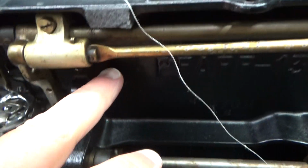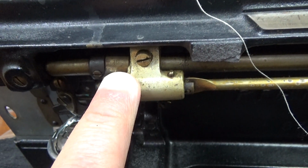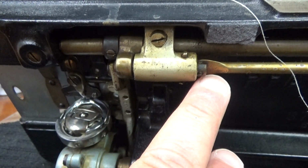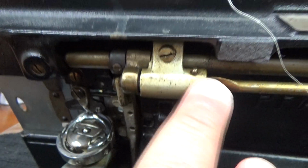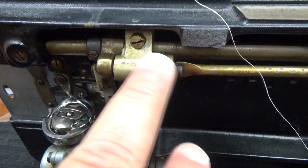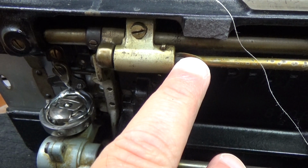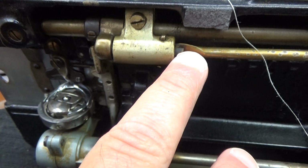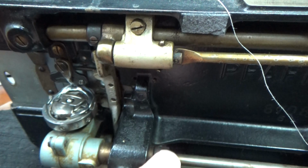We go across the main shaft. You can see we've got quite a bit of buildup right there. And this is going to be a critical part right here, because when you're trying to drop the feed dogs, this piston is going to pop out. And if you have a lot of varnishing buildup in there, you're going to have trouble actuating that feed dog drop. It's all part of this assembly right here. So if you happen to own a 130 or 130-6 and you have issues with dropping your feed dogs, or it's not responding well, this is the area that you want to give attention to, because it probably has varnishing buildup and gook and dirt and small woodland creatures and everything else that have crawled in there and are preventing this little piston from shifting properly.